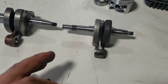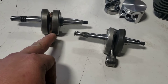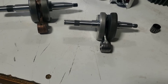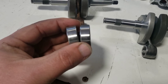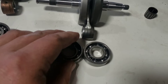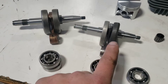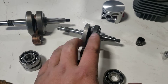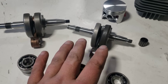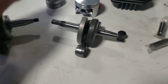Here's the Stihl and the Husqvarna crankshaft — just look at the sheer size. Remember, they both take the same pin. I've talked to people who have done the modification of putting the Husqvarna crankshaft into the Stihl, and I believe the Husqvarna crankshaft is stronger mainly because of the mass. The pin size is the same, the bearing is the same size. I sell used crankshaft kits for both online — I sell a lot more Stihl crankshafts than Husqvarna, though I don't know if that's because of the design or simply because more Stihls were made over a longer period.